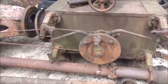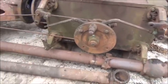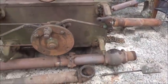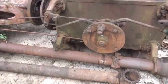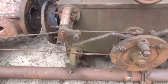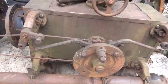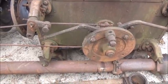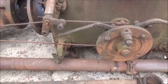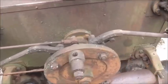We're going to get the steam pump out of there and get it loaded up, taking the homemade rollback. A lot of people commented on the suspension on that truck - when I was picking the engine up and set it down on one side it leaned. I've got air ride on it, and all the U-Haul trucks back then had air ride that would drop the back of the bed six inches when loading boxes. When you set that weight on the bed it's going to lean, then the self-leveling lever brings it back up. You just have to add air when adding and removing weight quickly.